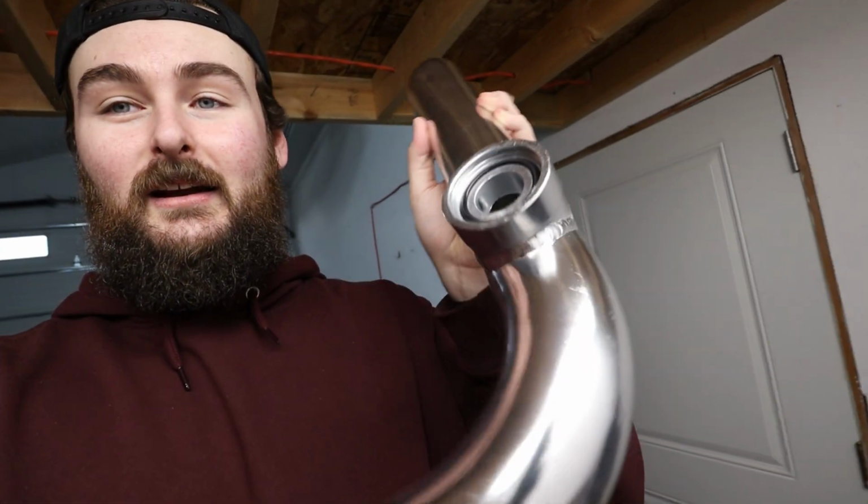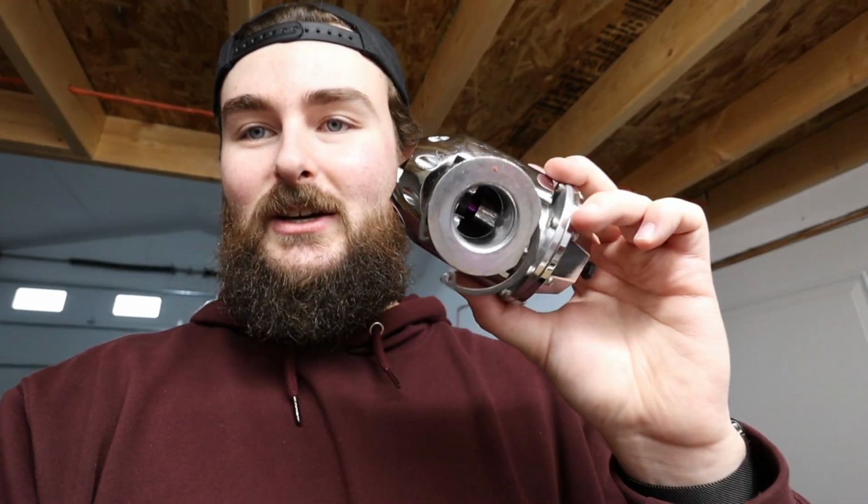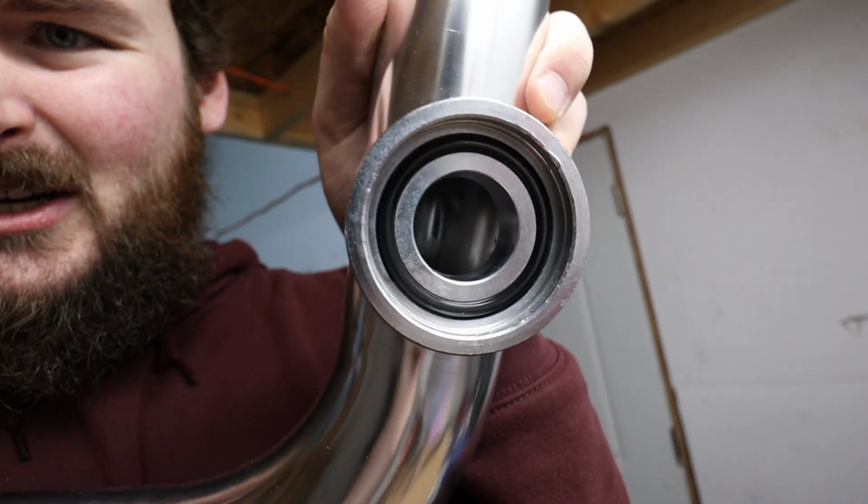But going back to the first video talking about our eBay turbo, that kind of leads us into today's video talking about this cold pipe, because as you can see, there is a nice spot for a blow-off valve on here. But if you guys have been following the channel, you know that this blow-off valve leaks and doesn't seat great. It is a Chinese HKS knockoff, and there is some grossies behind it. So we've got it pretty well cleaned out. It's pretty much ready to reinstall, but this is why I haven't.